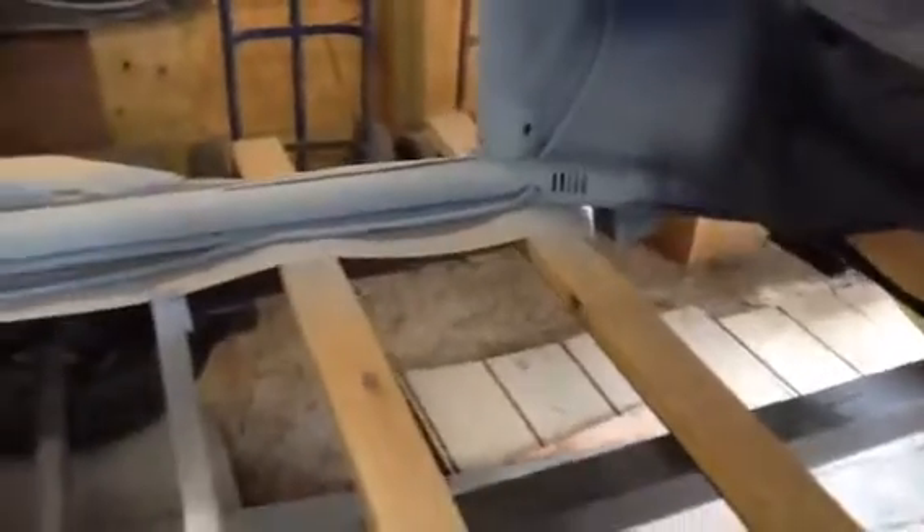So this is what you see — the 2K now on the whole exterior, obviously including the roof, rocker panels, and the vents inside. I hadn't gotten to them; that was one place I had to go to bare metal and epoxy before I could put the high build on top of it.